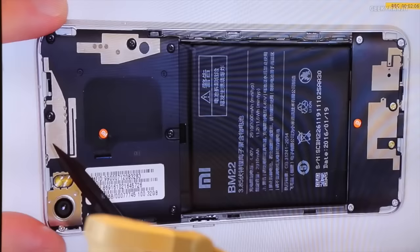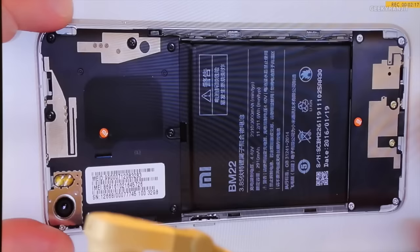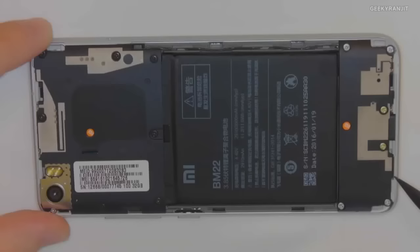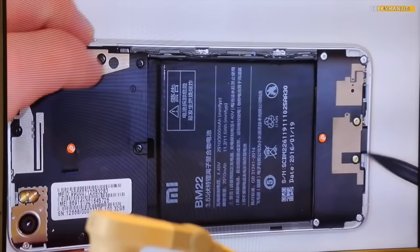The way this works, it's basically like a thermoplastic material that's applied, and you coat it with this metal plastic additive, and that is sensitive to laser. So in the manufacturing process, you basically laser sensitize this area, and then you essentially bathe it with this sort of metallic additive, which then sticks to the surface. So this is kind of like a metallic coat of paint that is applied, and which serves as the antenna, as the primary antenna.